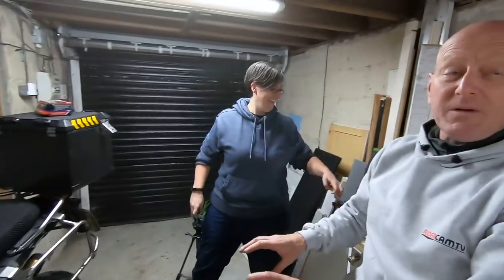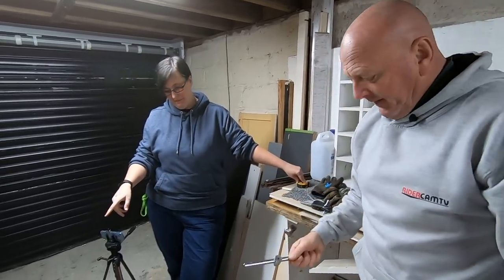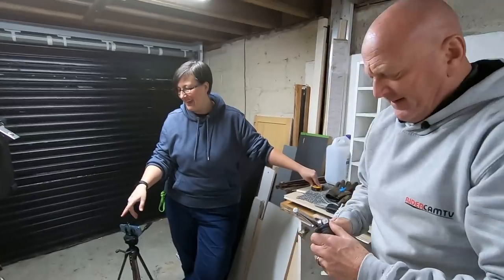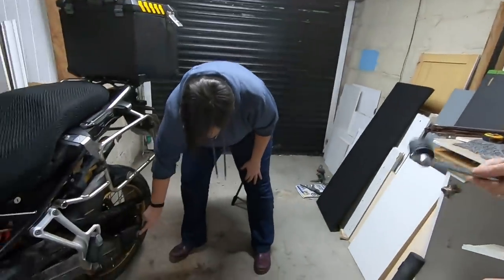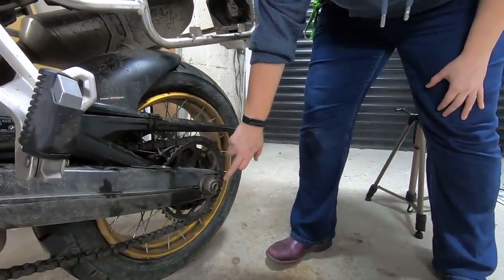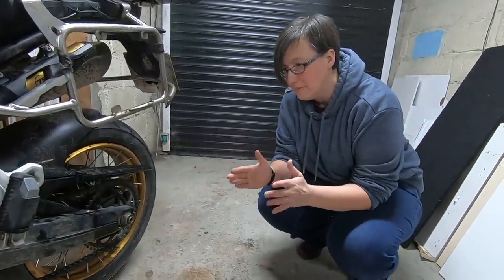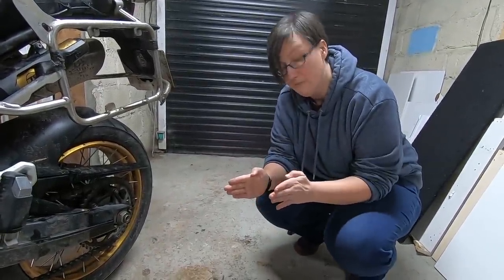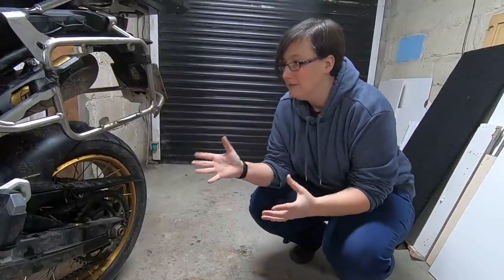What do I need to do? First, we're going to loosen off the axle nuts — not take them off, just loosen them up. The reason is we want to be able to move with the adjusters. We'll loosen this one off and do the adjustments on the side here. It's really important that because there's one adjuster on each side, we do them uniformly — if you adjust one slightly more than the other, you'll tilt the wheel within the swingarm, causing uneven tyre wear.